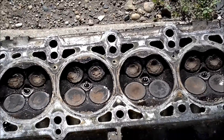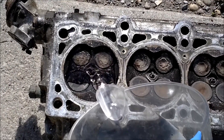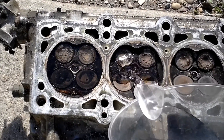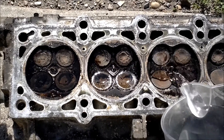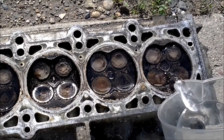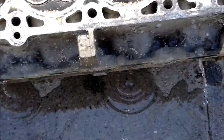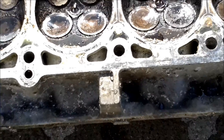I've got water here to show you. You can pour it into the cylinder head and fill it up. And if the valves are bent, this might not necessarily show it — well, that one showed it very well. Just pour it right out of there. You can see there are three of them that have really bent valves — you can see it flowing out. Actually, all four of them look like they're leaking.